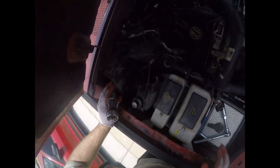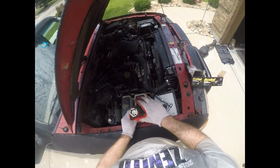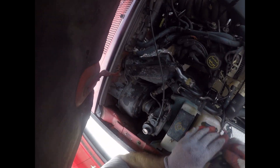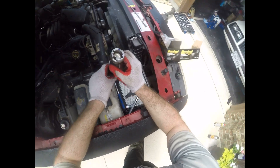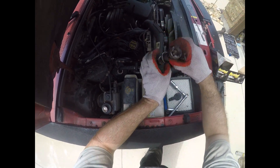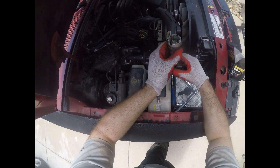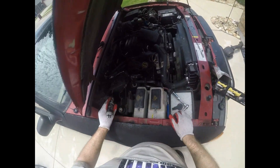When I installed my original one by marking the original and moving it over, I didn't do a very good job — it's off a tad bit. So I'm going to go ahead and fix it. If I can find the tool, I'll put it on, which just keeps this in position when you drop it in. I'm going to fix my cam shaft sensor because I'm still at top dead center, and it just needs to be fixed a tad bit.